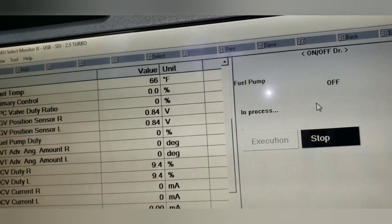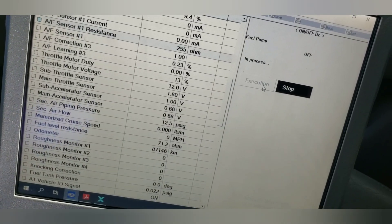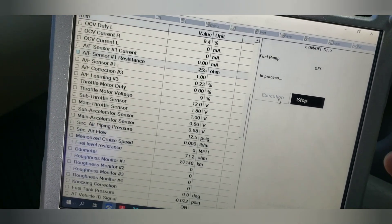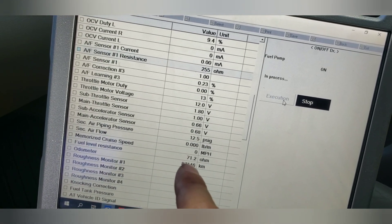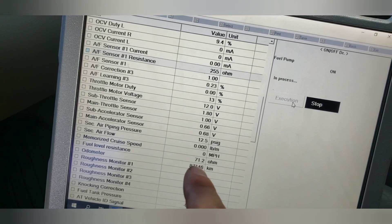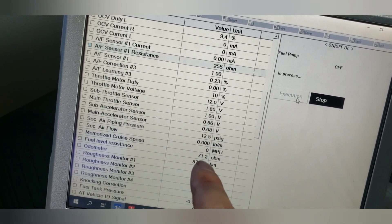It's going to take probably about 20 minutes to pump enough fuel out of the vehicle in order for me to put in some fresh 91. Another thing I forgot to mention: so that you don't run the car completely dry and burn up the fuel pump, you can actually monitor your fuel level resistance. This doesn't give an accurate representation in gallons, but the ohms go from zero meaning full to 90 which means completely empty.